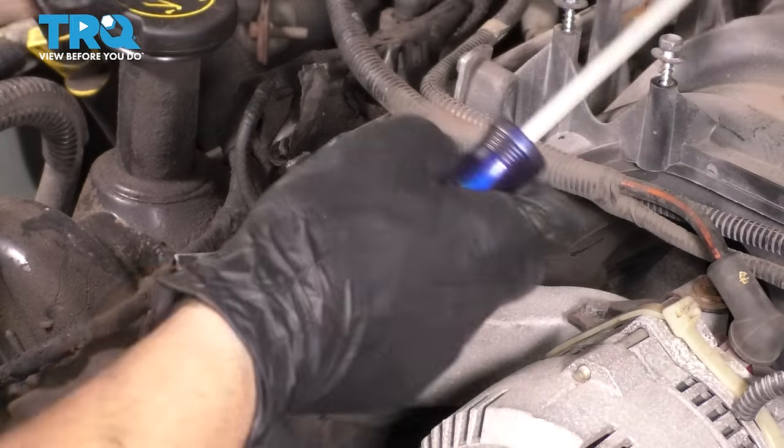Now I'm going to put the guide that goes on the tensioner, but I won't put this tensioner in yet. I think on the other side I should have waited to put the tensioner in. I had a harder time putting the chain on than I would have if I didn't have the tensioner. So I'm going to leave it like this, put the chain on, and then put the tensioner in. Hopefully that makes a difference. And now let's get the chain on.